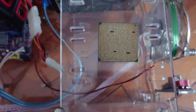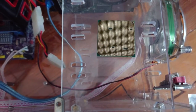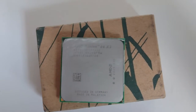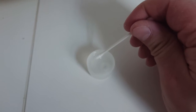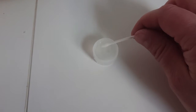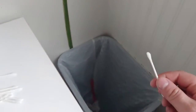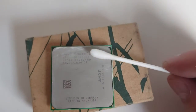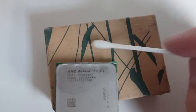I'm going to pause the video and we're going to move to the next step for cleaning the old thermal gunk off the CPU. So I took the old CPU — it is an AMD Athlon 64 x2. What I like to do to get the thermal gunk off: I just take Q-tips and rubbing alcohol. I pour the rubbing alcohol into the cap and dip the Q-tips in, shake off the excess, and wipe while rotating. You can just swirl it around — that gets the job done and cleans off all the old CPU gunk.